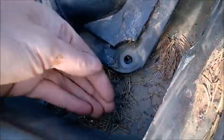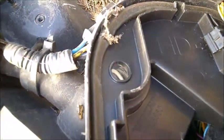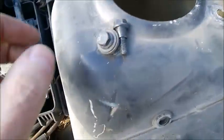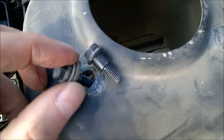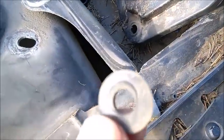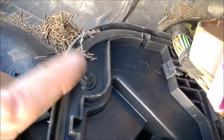There are small holes on the side, and these holes do get clogged. There's another one on the other side, so there is water rising here. The cover has a seal — a rubber seal — which obviously may not last 15 to 20 years and will start to leak, especially if it wasn't tightened properly. There are four screws, and they use a specific screw with a metal washer and a rubber washer underneath. This has to be really sealing, otherwise it's going to leak in there.